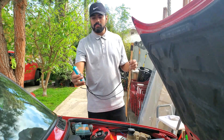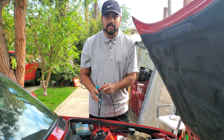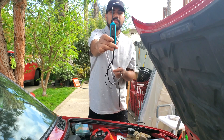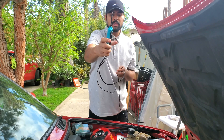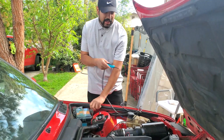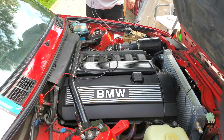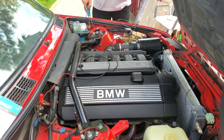So let's get started. I just want to point out — hitting that button gives 12-volt current to the end of the probe, and this one here should go green, giving ground to the end of the probe. So you're able to do both voltage and ground testing. We're going to turn on the electric fan of my car — the key is out of the ignition, the fan is not on — and there you go, it's on right there.